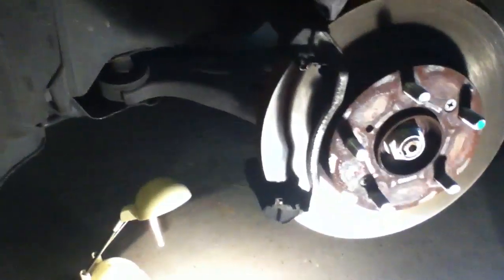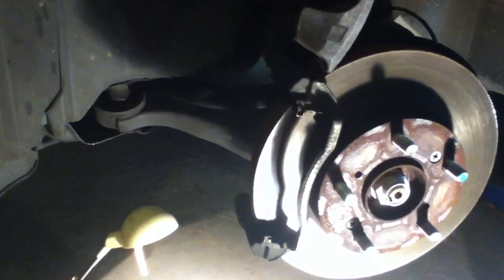That's where the bolt was. Your caliper pops right up, and once your caliper comes up, here is your rotor. You're going to find your brake pads — one on this side and one on this side. If your brake pads are a little bit stuck on to the rotor and they're being stubborn, take a flat head screwdriver and pry them off.